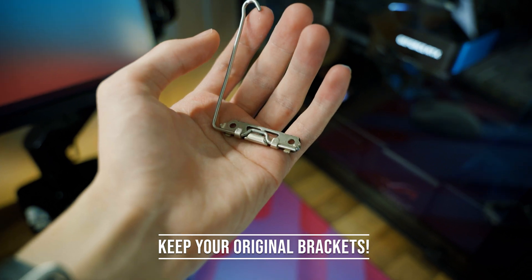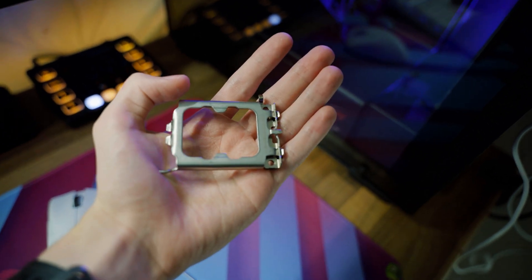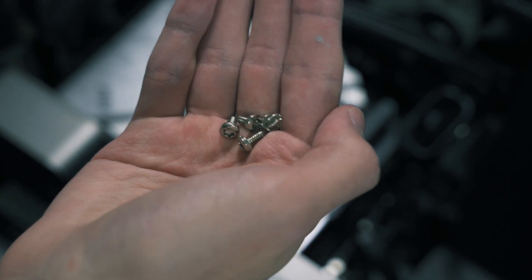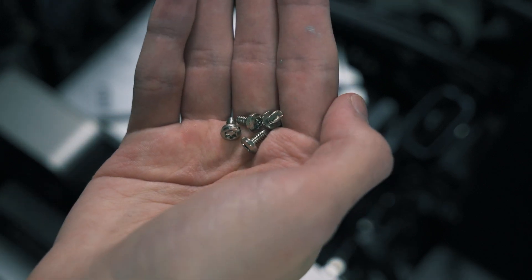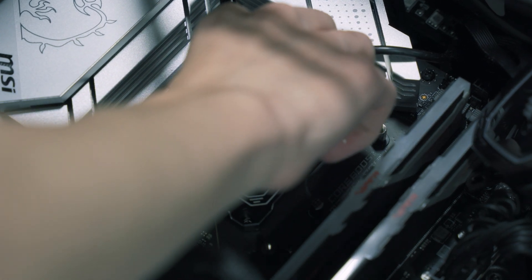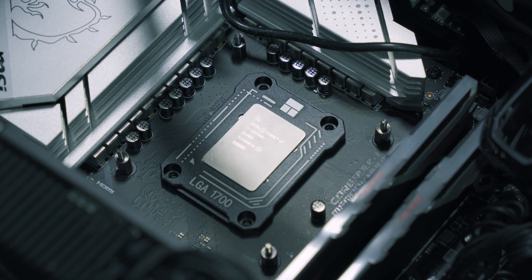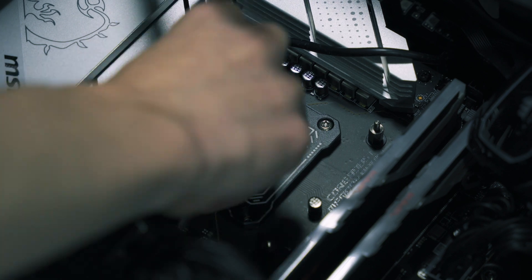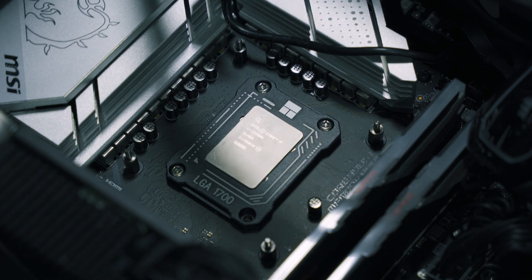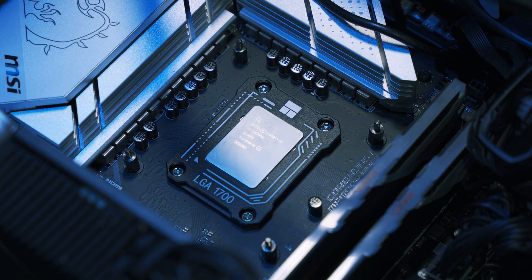Make sure you hold on to the ILM because you might need it when you come to sell your motherboard or if you ever need to RMA it — store it somewhere safe. Also hold on to the four hex screws as you will need these when installing the contact frame. To mount it, gently place the contact frame on top of your CPU socket while your CPU is inside, making sure all screw holes align. Then place all four screws in and tighten them in a crisscross pattern to ensure an even distribution of pressure. That's it — you've successfully mounted a contact frame. Now just install your cooler as you normally would.